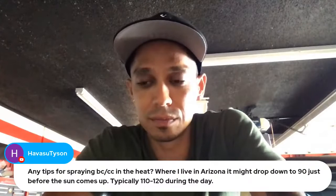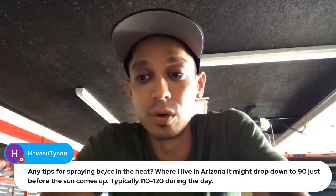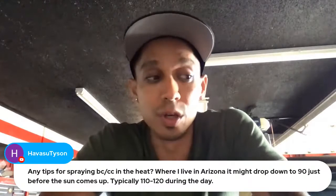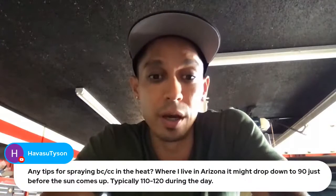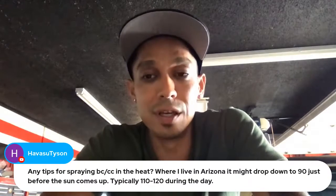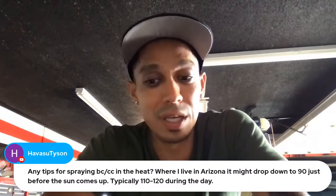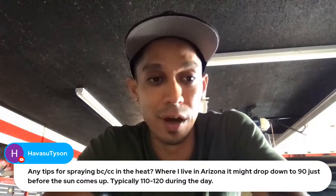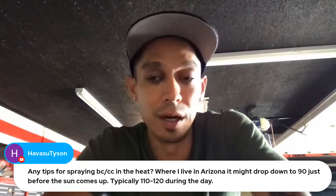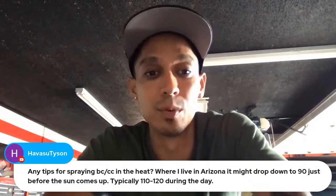90's hot already. You could do a complete paint job in 90, but at 110, 120, your clear coat's going to start curing pretty quick. So you're in a race against time. Definitely use a slow reducer, slow hardener, okay? Because the heat is going to compensate for the cure time. And just try to paint as quick as you can if you're doing a complete paint job, and make sure you're laying it on wet. That's the number one thing.